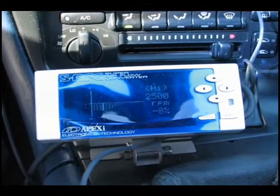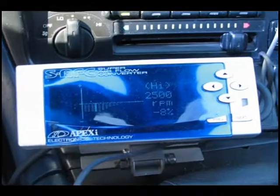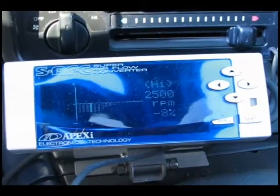This is the AFC's high throttle map. At this point in tuning we are taking out fuel only in the lower RPM ranges. For this run we've got the fuel pressure regulator set to 38 PSI as the base fuel pressure, the AFC taking out some fuel in the lower RPM ranges, and the boost set to 22.6 PSI. Let's try it out.